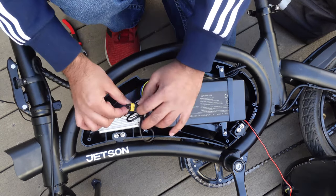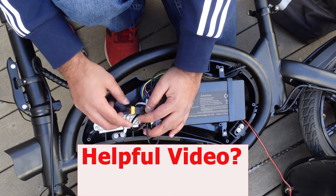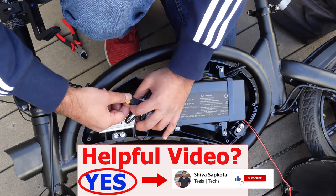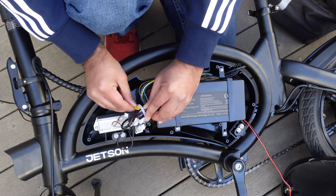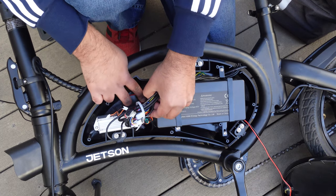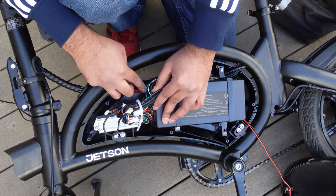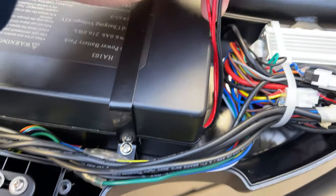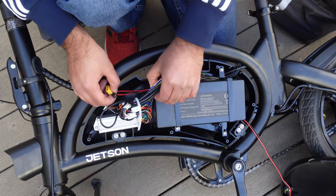One zip tie is out. Right here is your main battery connection — I traced the cable and the yellow-black connector is your battery connection. I'm just going to pull this out and disconnect it. Now the battery is disconnected. There's the battery cable and the battery charging cable — there are only two connections to the battery. I've disconnected all of them and can now safely remove the battery.